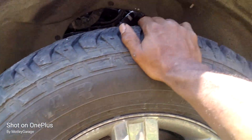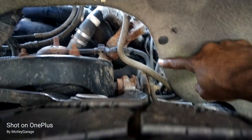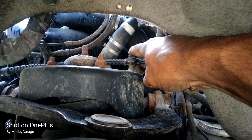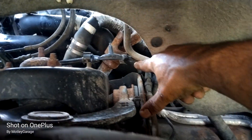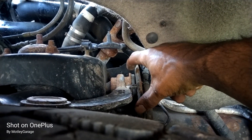I might end up jacking the truck up and seeing if I can go through the wheel well here. But I got to take all the turbocharger charge pipes off. I was just watching a video where this dude took all the charge pipes off, and he was saying you don't have to take them off to get to the oil sending unit. Actually, I can see it — it's right behind the alternator, right in between these two pipes here. It's kind of dark but I can see the silver. If I had an extension that could go right in between there and just boop boop, then pull it out.